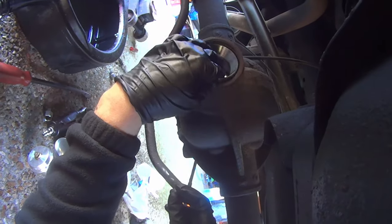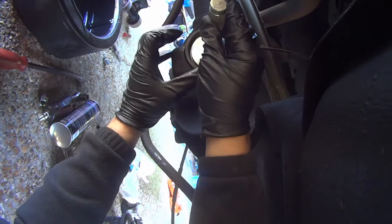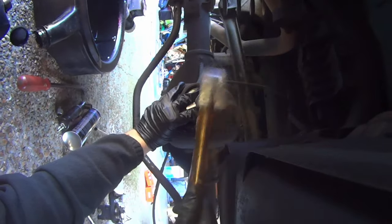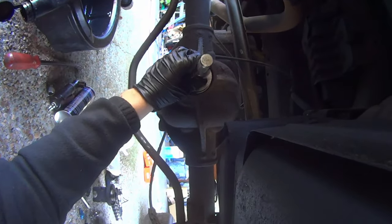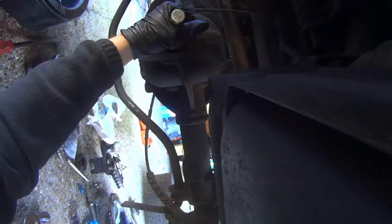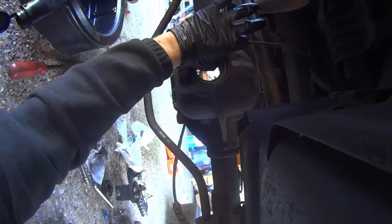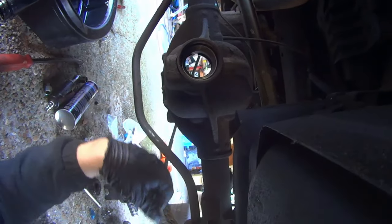Get the race in position. Just take the driver and drive it home. Do your best to make sure it goes in flat and even. When it starts raising up on one side, you're going to have to give pressure over there. Run your finger along the back side and make sure it's flat.